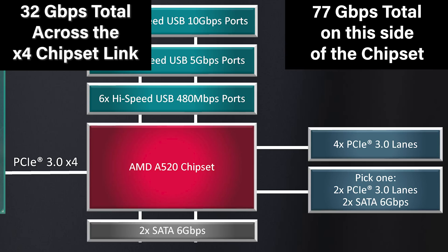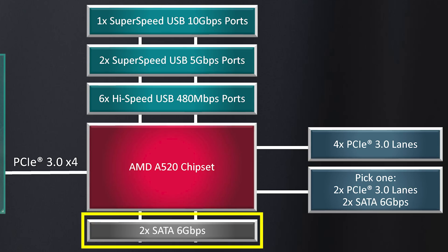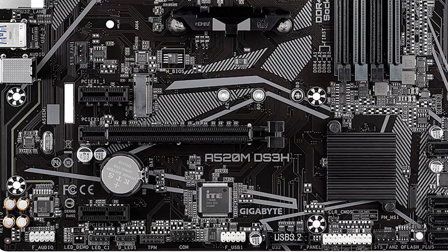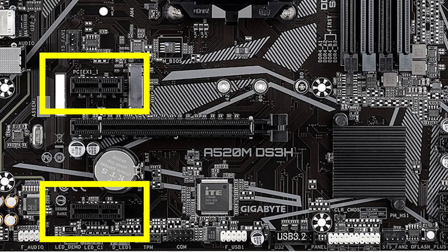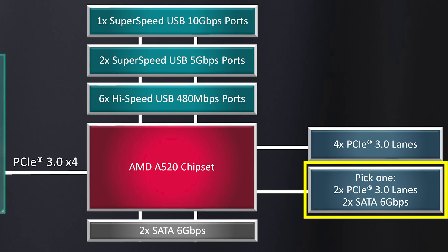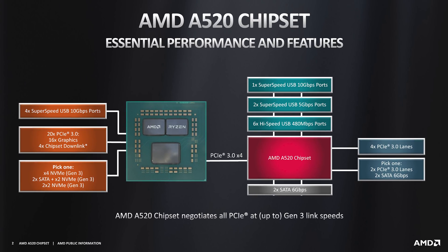But how often are you using all the ports and all the lanes at the same time? Take a look on the right-hand side — do you see the four PCI Express 3.0 lanes? That's for a second M.2 slot. Then you have two SATA ports dedicated on the bottom, and then you have the option of two more SATA ports or two more PCI Express lanes. Here's what often happens: you have one or two 1X PCI Express slots on the bottom of the board, but if you use them, then you lose SATA ports. Or conversely, the M.2 slot shares lanes with the SATA ports, which is why on some boards, if you install an M.2 drive in the bottom slot, you actually lose a pair of SATA ports — and that is why.